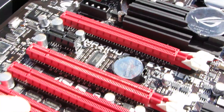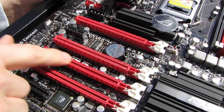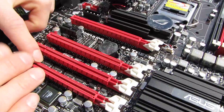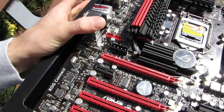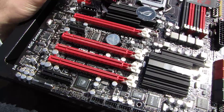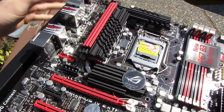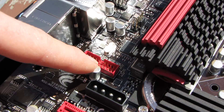There are four PCIe 16x slots. Three of them are wired for 16x and run off the NF200 chip; the fourth is only wired for 8x. If you install three cards, you'll use the first three slots with no room for additional expansion cards. There's also a PCIe 1x slot with full bandwidth regardless, and a PCIe 4x running off the chipset — also full bandwidth regardless of what's in the other slots. The three main slots should run at 16x16x16, or possibly 8x8x8x8. You can't run four-way SLI or Crossfire anyway, unless you're folding at home.